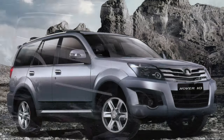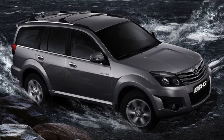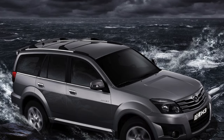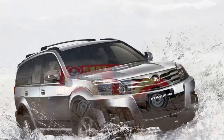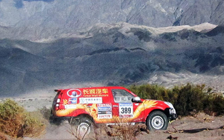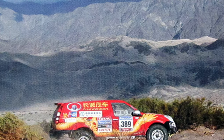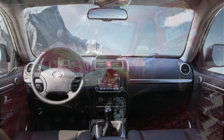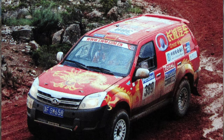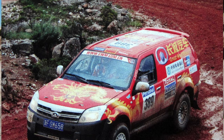The door locks break as quickly as the locks of Lada cars. If you open the doors often and slam them hard, they can break in the second year of the car's operation. When purchasing a car secondhand, check how well the locks are preserved — just open and close the doors and listen. If there are no characteristic rattling sounds, then the locks are safe and sound.